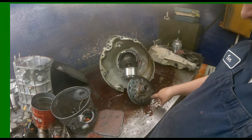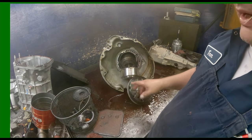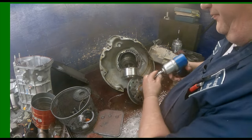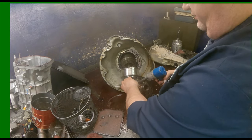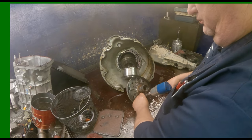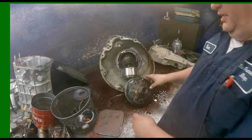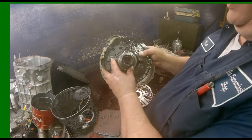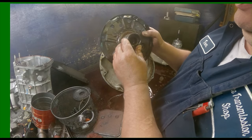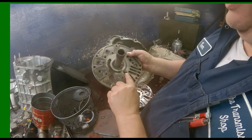A lot of times on these pumps, this one's not going to be that way, but these get really close into here, and sometimes you have to use a chrome socket. A 1/2 inch. Your washer's okay, no ring cut in here or in here. Check the condition of your bushings, how this surface looks right here.